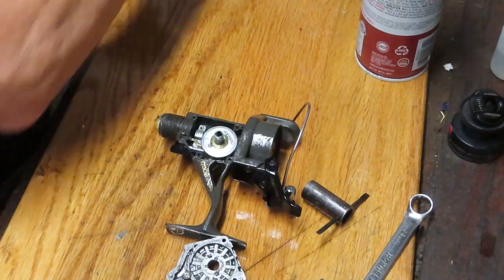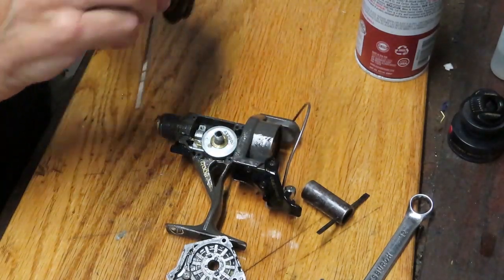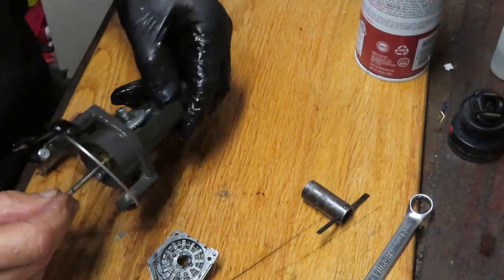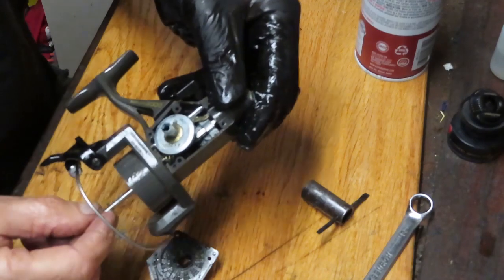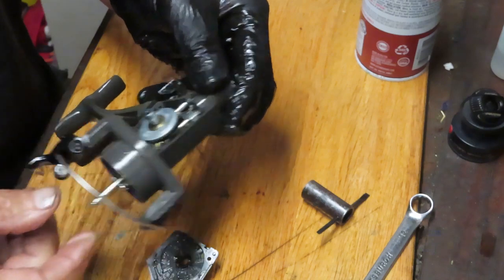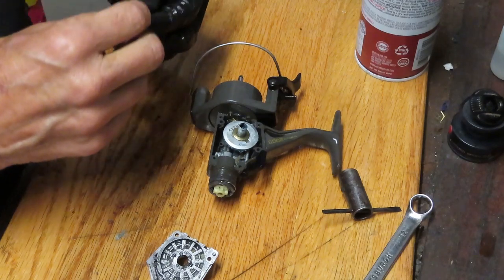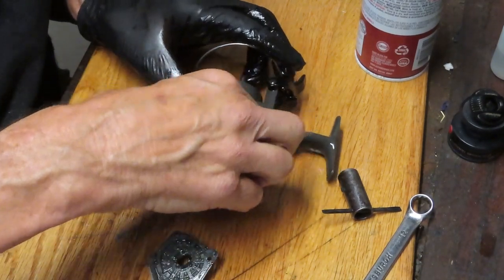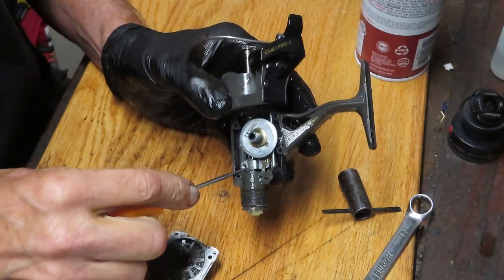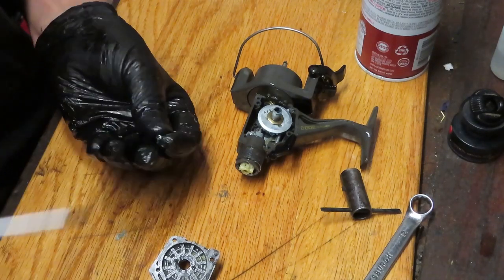And we can bring our axle shaft with a light coat of grease through the pinion gear, flat side facing out, through the crosswind block, and then merge it into the drag stack. There's a slot above and below on that axle shaft. Get the teeth of that clip on it. On both sides, it's a double C clip, and align the hole for the tie down screw. Of course, go to your case for that tie down screw.